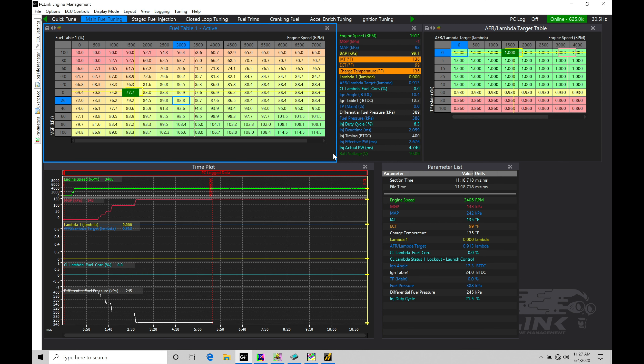The other part effect is going to be a cooling effect. If we're spraying that water solution, it's going to have a high latent heat of vaporization, meaning it's going to be taking any of the temperature coming in from our compressor, from our turbo or supercharger, and cooling that down. We would have an intercooler already, but the water meth injection is going to cool it even further and allow us even greater control over our spark timing to get more power out of it.